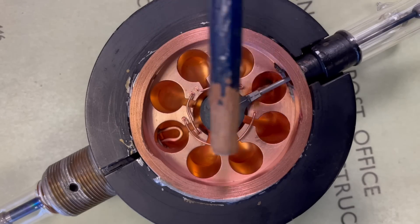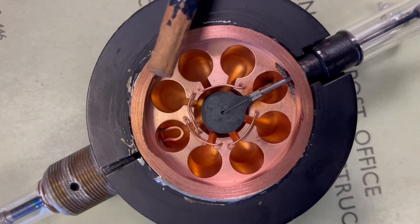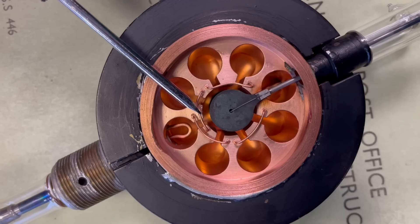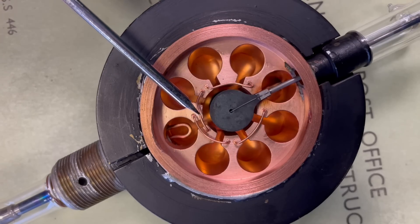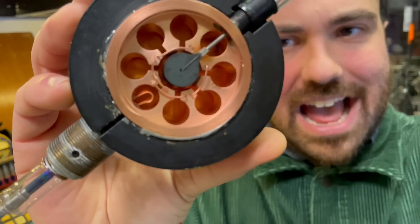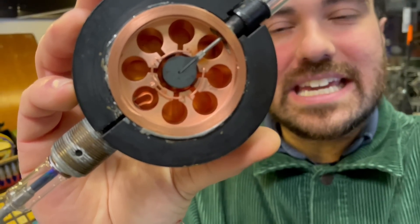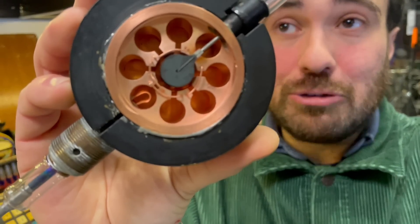If you move it fast enough, our persistence of vision tricks us into believing there is an image on the screen. The magnetic field in a cavity magnetron actually makes the electrons spiral around inside the interaction space — this idea was taken from an earlier device called a cyclotron. Eventually, after cycling around a bit, the electrons hit the wall of the anode and you get a slightly more negatively charged region, so now you have slight voltage differences within the anode itself, and that creates current flow as those differently charged regions try to even out.